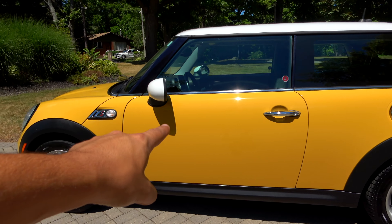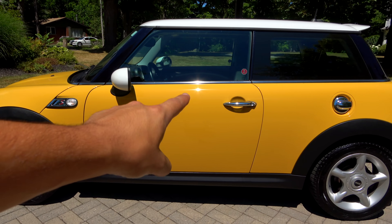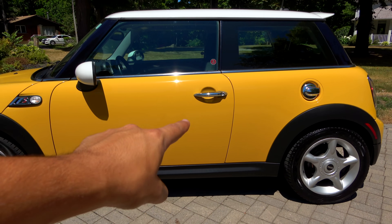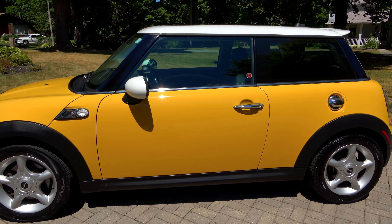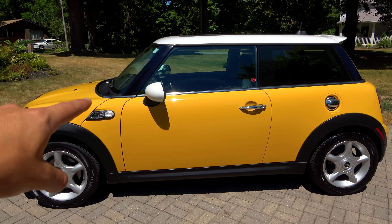What's really nice about running a DA versus a rotary when polishing paint is that in the sun's reflection you're not going to have holograms — which are micro scratches in the paint from polishing left to right. With a rotary you'd see those mini scratches after you're done. With a DA, especially with the washer mod, you won't run into those issues. If you have any questions, throw them in the comments below. Thanks so much for watching — catch you in the next one.